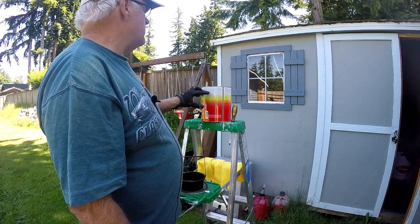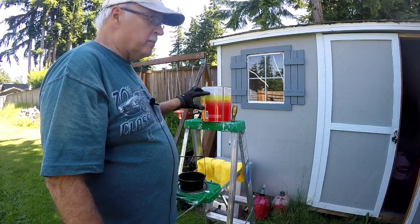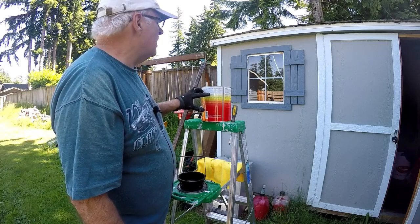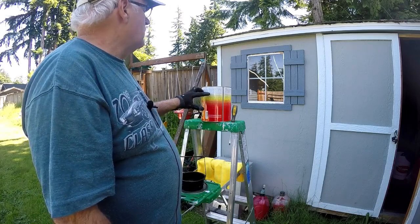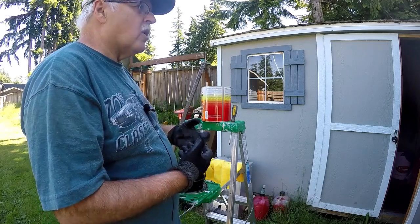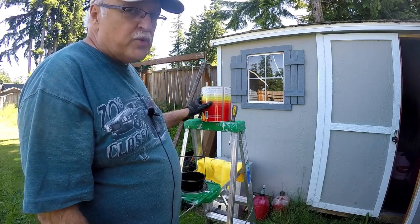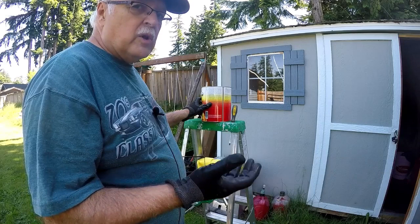Chem Dip is safe to use with most metals and alloys. Limit soaking time of coated aluminum finishes to a maximum of 4 hours. Cast iron and other low alloy steel should be coated with penetrating oil after you're done soaking it in this product. Berryman also has a product with this oil in it that you can put the clean parts in, called Berryman Easy Does It, after rinsing to prevent flash rust. So cast iron parts will start rusting immediately if you don't coat them with something.